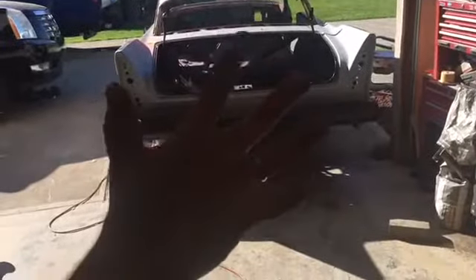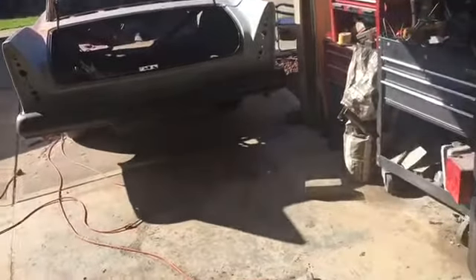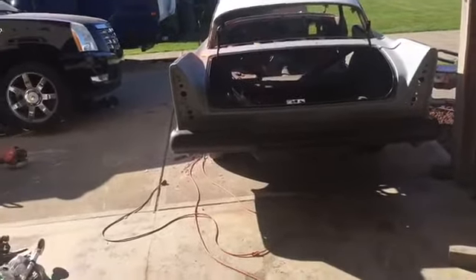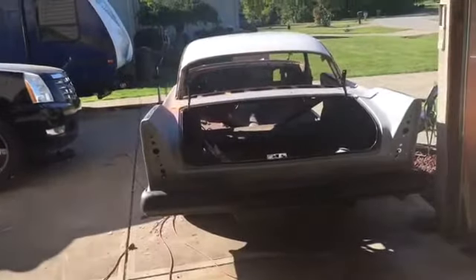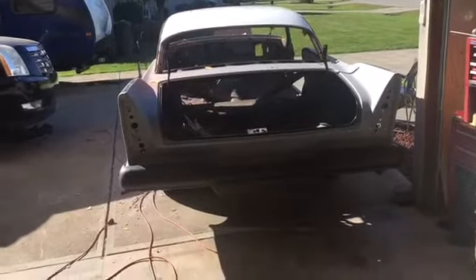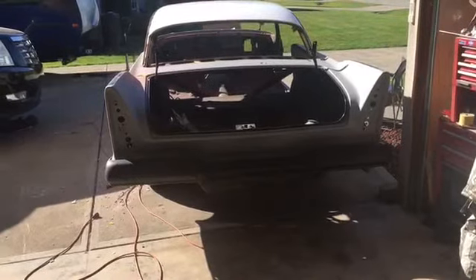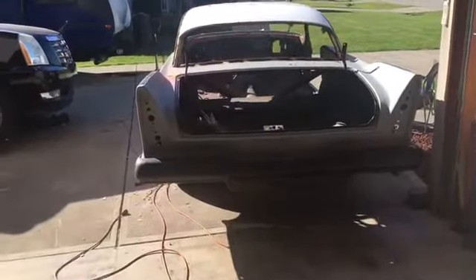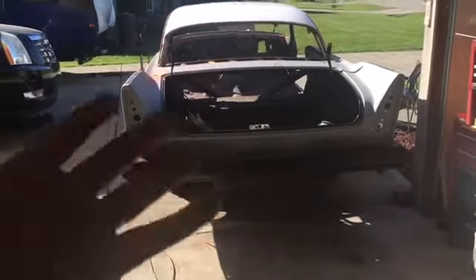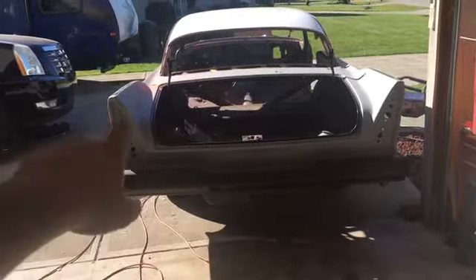Another option suggested to me was getting a buffer with an eight-inch pad and like 40-grit and going over it that way — not on an angle grinder, that'd be too much. I've pretty much thrown out sandblasting, though we have a sandblaster for the nooks and crannies. Getting it media blasted or body dipped — I could take it up to Indianapolis or Cincinnati and get it dipped for about a thousand dollars. That'd take care of it all at once, but that's money I could spend on numerous other parts I need.